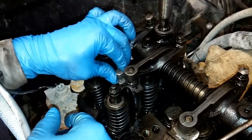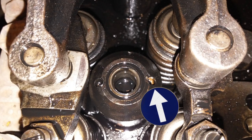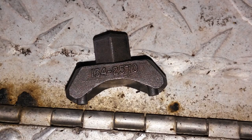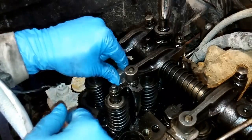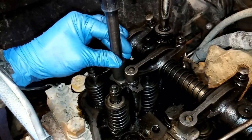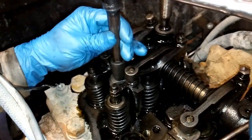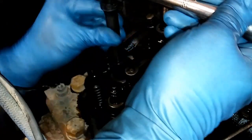This tool is basically a 9/16th drive bolt head with two little pins. You can see the pin holes in the retainer — that little tool goes into those bores. The CAT part number is 1342570. Once it's in there, you're going to want to get your ratchet or a wrench and put some downward pressure while loosening or tightening, because the pins are actually pretty shallow and it tends to want to jump out.